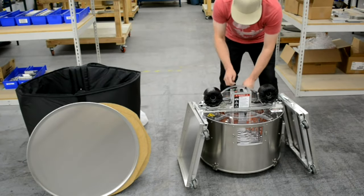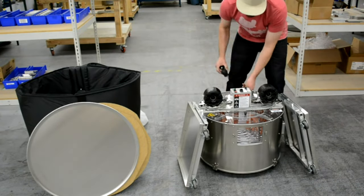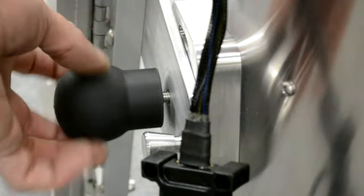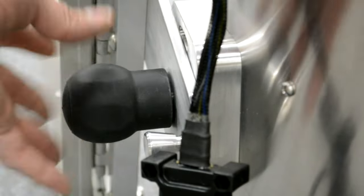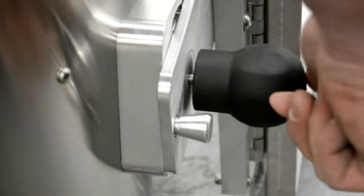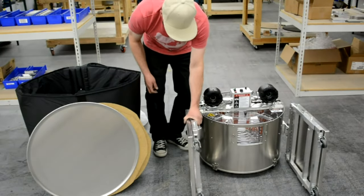Open the inner lid and remove the two drum knobs. Disengage the plunge pins and fasten each stand assembly to the drum using the drum knobs. Be sure to leave both knobs loose three to four turns to avoid self-tightening when walking the unit upright. Extend the lower stands from the upper stands until the snap buttons lock.